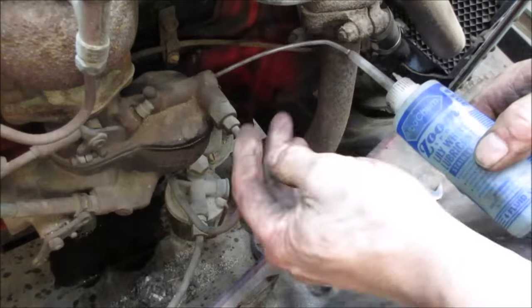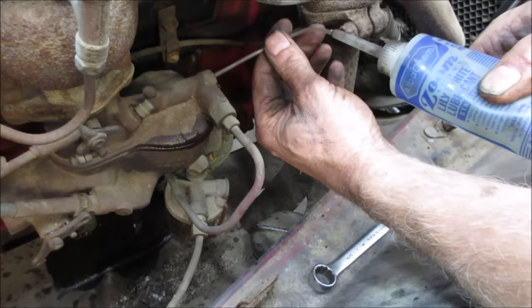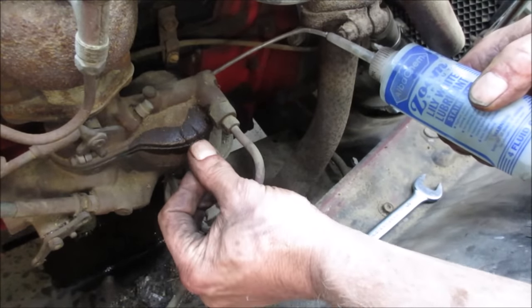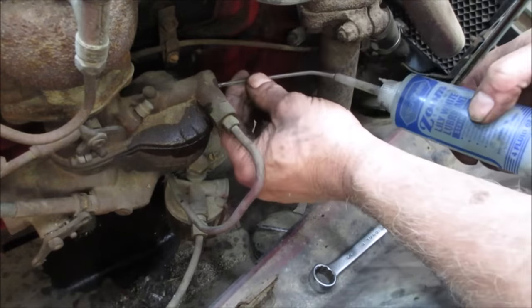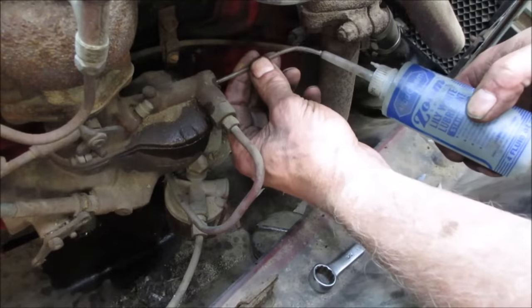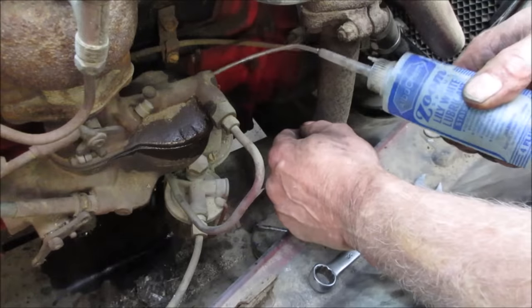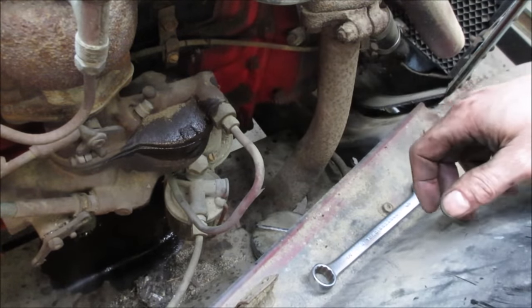It's pissing right out of, we're pissing out? Yeah, it's literally coming right out of the base of the gasket right here. If you can stick your fingernail in the carburetor, is that a bad sign? Yeah, we're going to have to take that apart. Plus, I don't know if the float's stuck. That would inhibit this from filling right now. Okay, going slow. Yeah, float might be stuck.